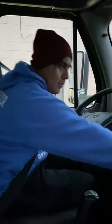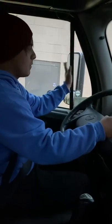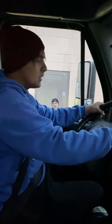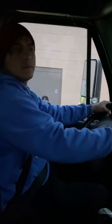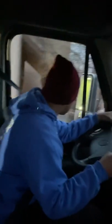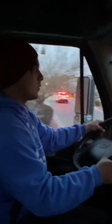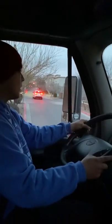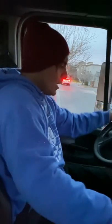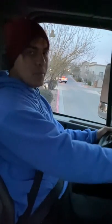Okay, so I'm gonna move forward up to 5 miles per hour. Always, guys, check there's no traffic coming from your left because trailers can't be crossing because it's a rest area. It's clear. There's up to 5 miles, clutch and smoothly braking. Okay, my service brake is working properly, my speedometer works properly, and my truck did not move left or right. I wanna go back in reposition.